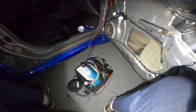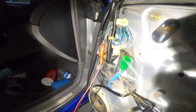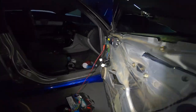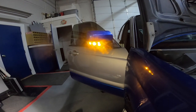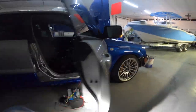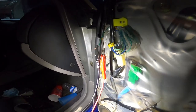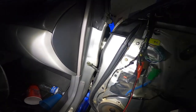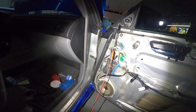So real quick, I wanted to show you guys the setup. I basically got a couple jumper wires here coming from the battery. I've hooked the hot up to the white wire and the ground up to the green wire. And if we roll around here, we can see that the turn signal is lit up. So now we know: the white wire is power and the green wire is ground. We're going to have to somehow get a wire from there up to the front of the car.